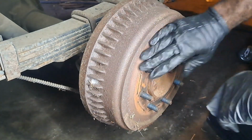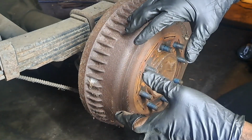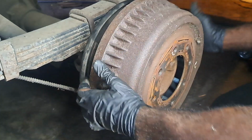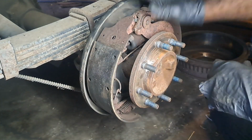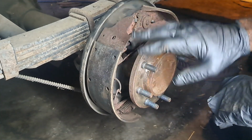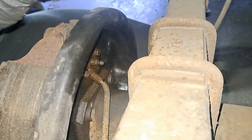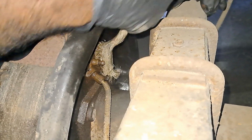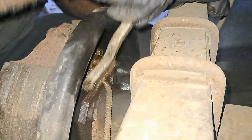So pretty much the other side was everything that I had to deal with to get the wheel cylinder out, but you're pretty much gonna be hanging around to watch me clear up some rust. Now, I already pulled this off and inspected the wheel cylinder, cleaned it with aerosol brake cleaner. It looked a lot worse than this. Only thing I'll be doing here is the same as the other side. It's just prepping the area. This was the hardest part, getting the line off.